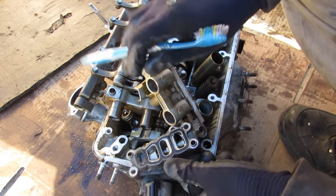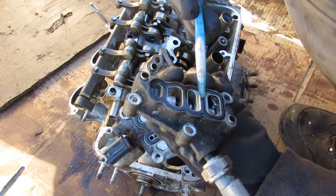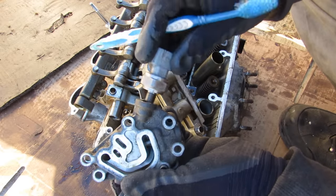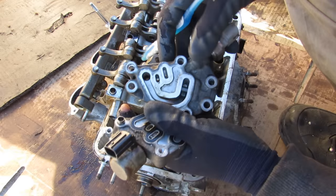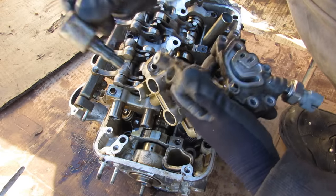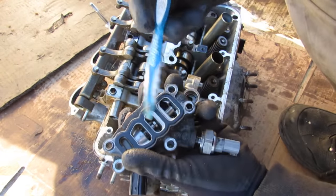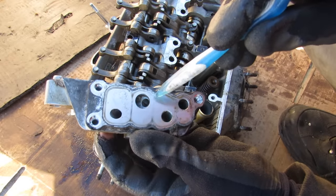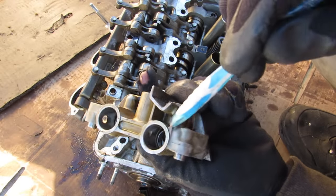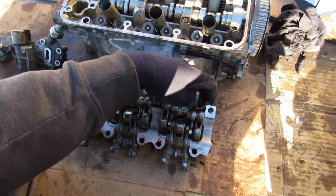Taking this apart, you can see the oil pressure travels back through this hole and into this section where there's a filter screen. Just like the spool valve in VTEC, there's a little filter built in and also a pressure transducer that tells the computer you've got enough oil pressure to engage VCM. The oil then travels back through these little passages and forms this little smiley face around the solenoid, redirecting oil pressure over to this port and sending it back through these holes. That oil pressure is sent through these two little holes which correspond to the two rocker arm shafts.